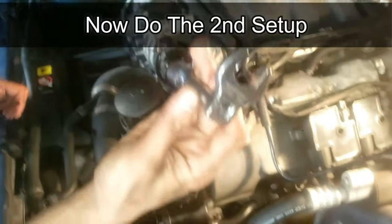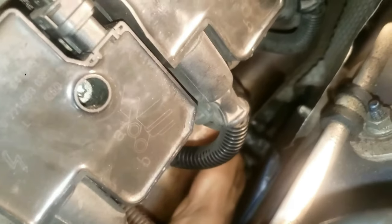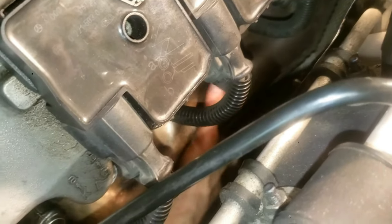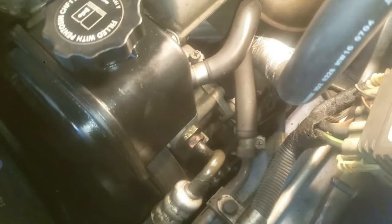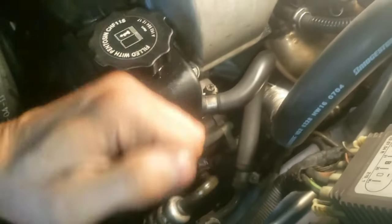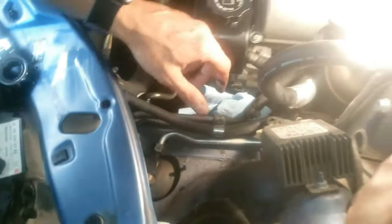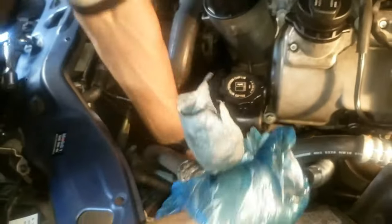Every time you do this setup you are turning and loosening the nut. Eventually the goal is to feel some oil coming from the bolt and to loosen it with your fingers, no longer needing the crow foot wrench. This may take some time but it's easier than getting on your back and removing the engine motor mounting. Moving on to the other bolt, which is a breeze to remove — use an 18 millimeter wrench to loosen the bolt, then remove it with your fingers. Make sure you also get the O-ring. Once you loosen the nut completely, pull the long stem out and have some oil pans below to catch any oil that comes out.